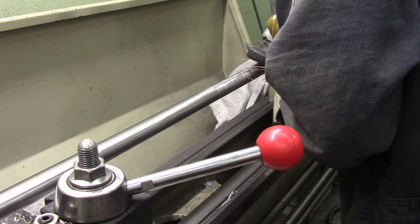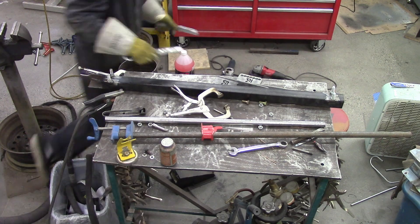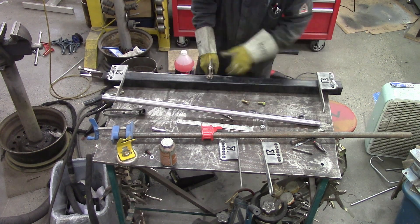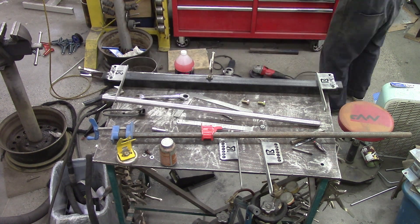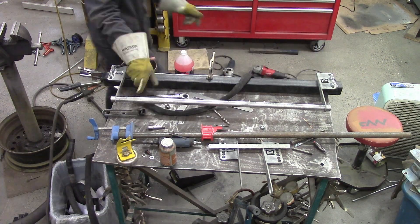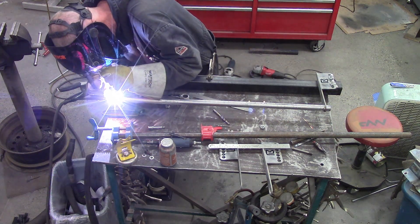Don't wear gloves. Blasted again. And I drilled more holes because I measured wrong and it didn't bolt up — I had to drill more holes for in-between adjustability. Then I had to set up a boring bar because it was bigger than half inch holes but smaller than 9/16ths, and it just kicked my butt. So I got to use a little boring bar on the milling machine — not shown because there were words.